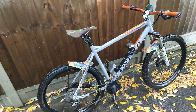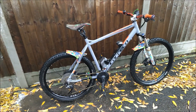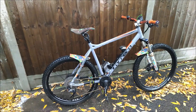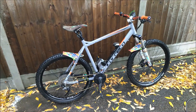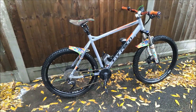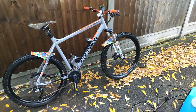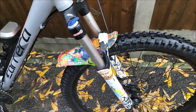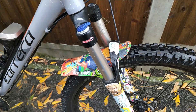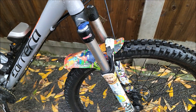Hopefully this video has been useful. To dry the bike down, just give it a few bumps up and down — drop the bike, allow all the drips to get out — and then give it a once-over with a dry cloth. Lube up the chain and make sure you squirt a little bit of WD-40 into any squeaky parts, particularly if you've got a suspension seat post like I have. Also, whatever suspension forks you've got, do not use anything abrasive and certainly don't use any degreasers or lubricants on those upper stanchions — those should just be washed down with soap and water and then dried.